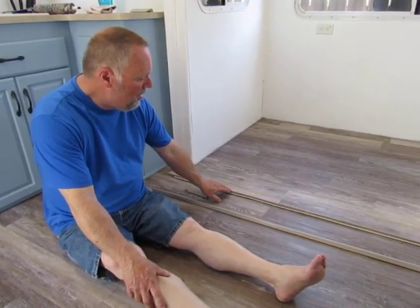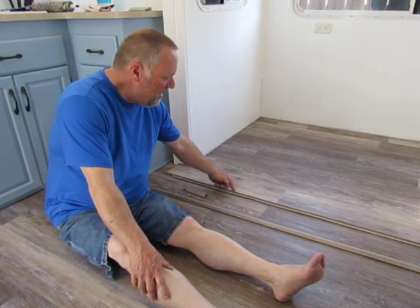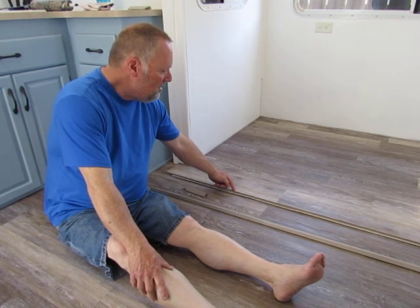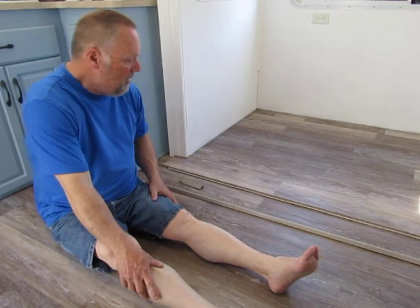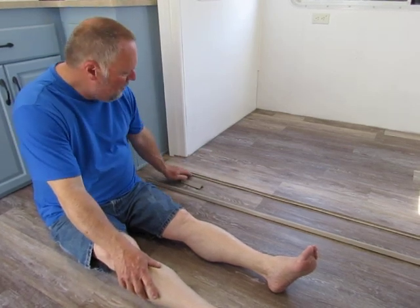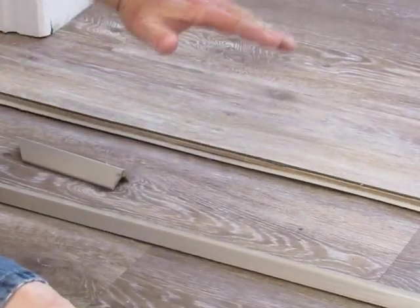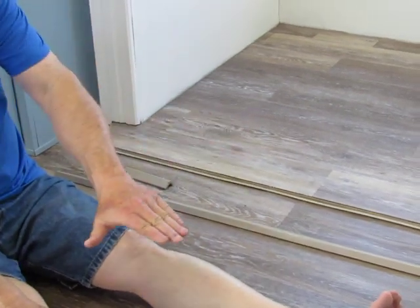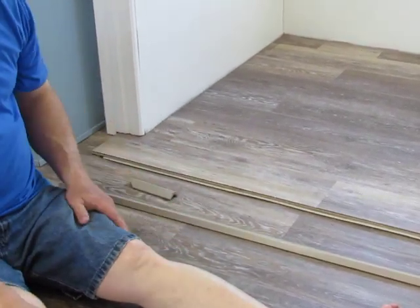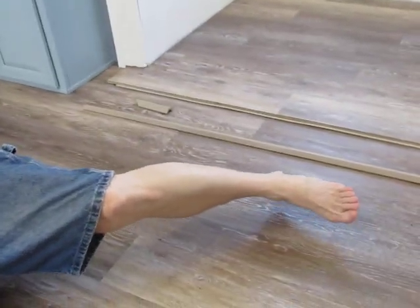The way I'm doing the slide out is I put a quarter inch piece of subfloor out to the edge, because our slide out was back here an inch back. So this plastic neoprene piece here is what it actually slides up on. It comes up out of the hole. This is a 45 degree angle and it slides into the coach. So I'll slide it in a little bit to show you how it is.